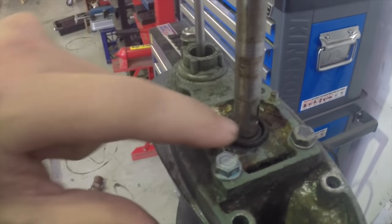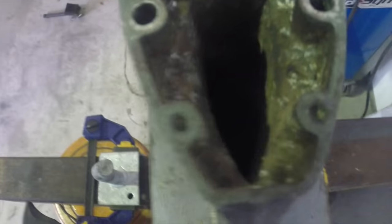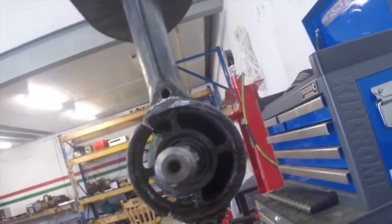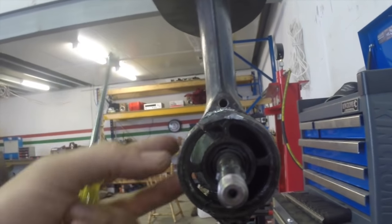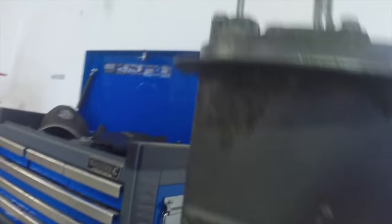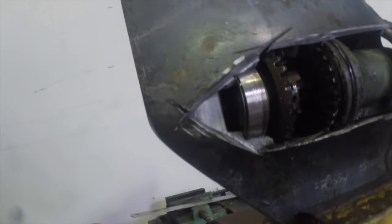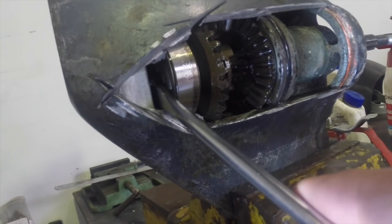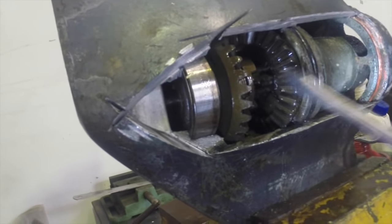Once again from the top — this is the oil seal from the drive shaft, and there's normally an oil seal around that gear selector as well. Looking down there with some light, you can see that's just where the exhaust goes straight down. This bearing carrier has those fins — they're the fins that your puller can hook around, or the outside edge here, if you want to pull this bearing carrier out. And the gear selector actually comes down into this section — there's a little rod here that allows the gear selector to push the dog clutch across.